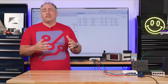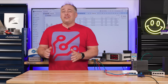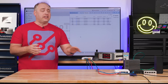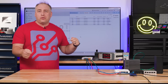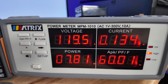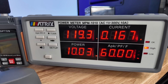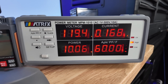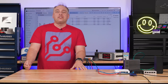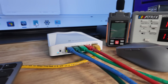If you have a management network at home that's all one gig, you can plug this in directly there — maybe to a PoE switch — and then have your high-speed ports used for high-speed things. In terms of power consumption: with nothing plugged in, you'll see maybe seven and a half watts at idle. With just a management port plugged in, you go to about 7.7 to 7.8 watts. When you start plugging in the 10 gig ports, you're going to see maybe two to three watts per port in additional power consumption. MikroTik says without any attachments you can get up to 15 watts, and with everything plugged in, up to 21 watts. We got around 19 watts, so for budgetary purposes, expect somewhere between about seven and a half and 21 watts.